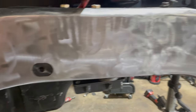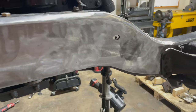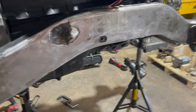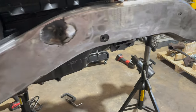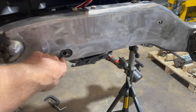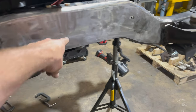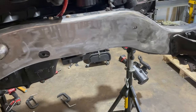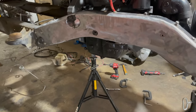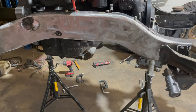It doesn't look like much because I completely fill-welded and then ground it smooth — giving me a nice thick flat frame rail to match everything on. This will be where the brake boss comes out, the shock mount, and probably a bump stop. One side down, made a lot of mess today.